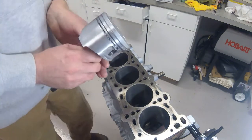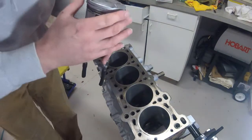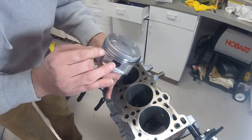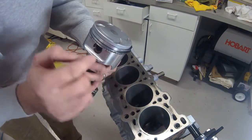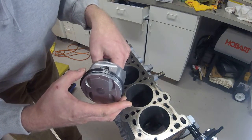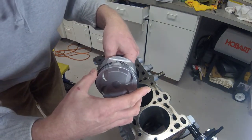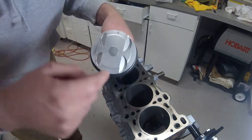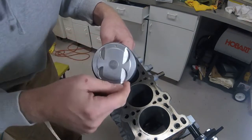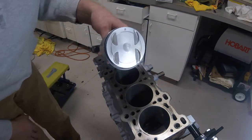Before I insert the piston into the cylinder I'm going to double check all my ring gaps. On your oil scraper — the bottom ring is 30 degrees offset, the top ring is 30 degrees offset from that point. On the front side of the piston, the wiper ring is 30 degrees offset, and the top compression ring is 30 degrees offset as well. Basically all these ring ends are offset at the valve machining points so every ring is completely offset around the entire piston.